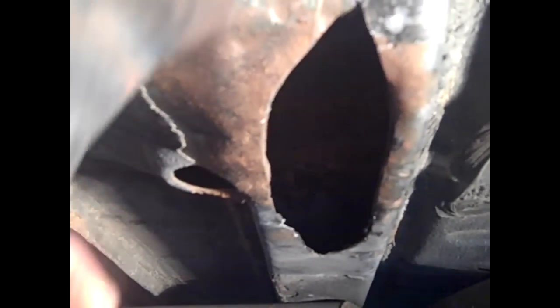Now we've got this giant gaping hole in our unibody. I cut it back a little bit further than I had to, but I wanted to make sure I got all the nasties out. So I started making this patch — it's a real nice thick diamond plate, the same stuff I used on my subframe if you watched that video. It's going to go on there like that. Now I'm going to do some more cleanup on this metal with the wire wheel and with a grinder to try to prep it and get it ready for welding.